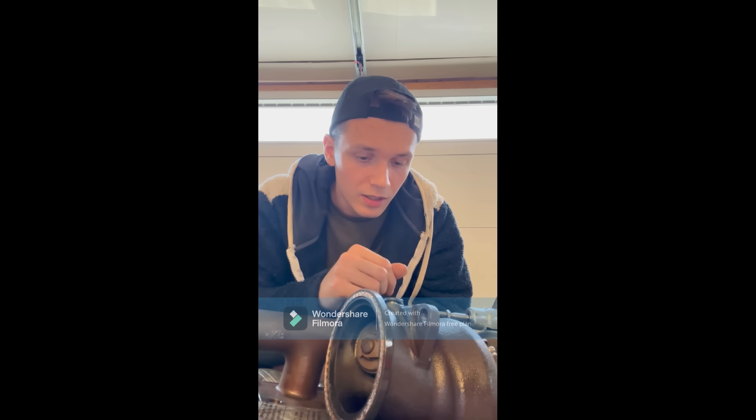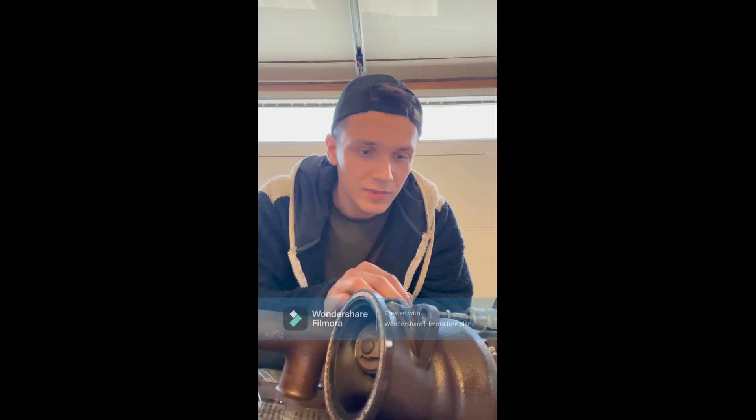The only thing left was to fix the timing corrections at the top end — just minor adjustments. The power felt great, but I expected more out of the turbo. It seems like Chris also expected more, due to the wastegate position always being so high in activation just to reach the boost goals. We already had high wastegate activation to reach 20 psi, which is kind of disappointing given the money I spent.